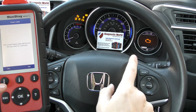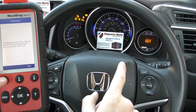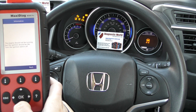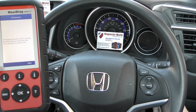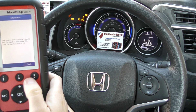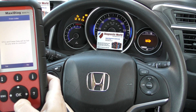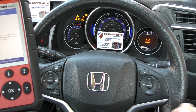You can see the check engine light there. We'll click yes. It's telling me the engine should not be running, but the ignition should be switched on. Some vehicles require this — engine off but ignition on. So we'll try that again and click on to erase codes.